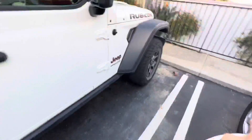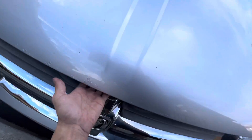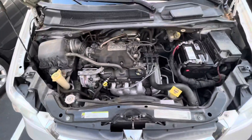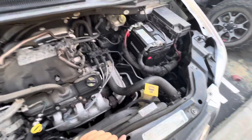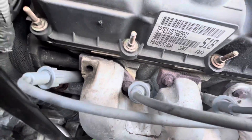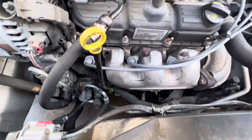Let's see under the hood. New ignition block, all the wires, all the spark plugs. New battery with the warranty. The exhaust leak is right here at the manifold — there is a bolt missing right there, as you can see, and that's where it lets the air out and makes the noise.